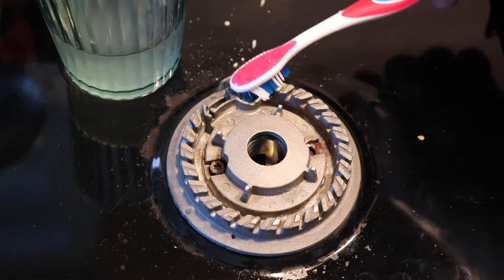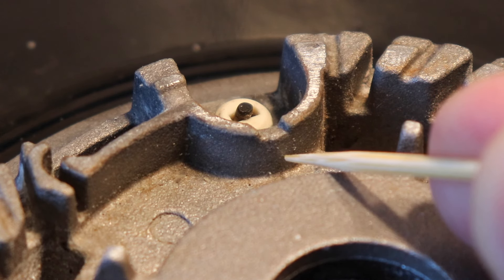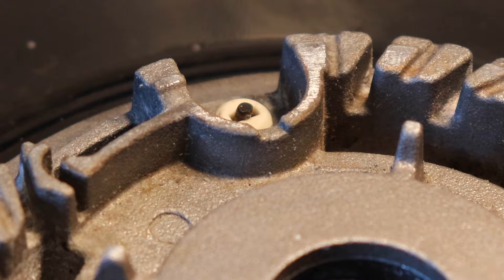So first you've made sure that the cap is on straight, then you check for food and debris around the igniter. The third thing you want to do is make sure that this little notch here is clear. This little slot allows the gas to get to the igniter. In some gas stoves they'll have a hole drilled down below here — in both cases you want to make sure that the slot and the hole are clear.